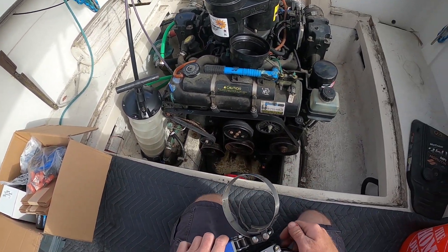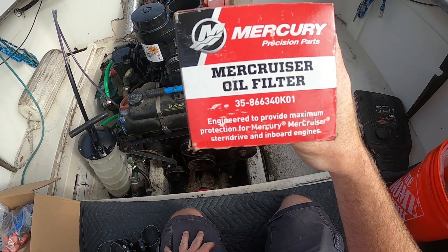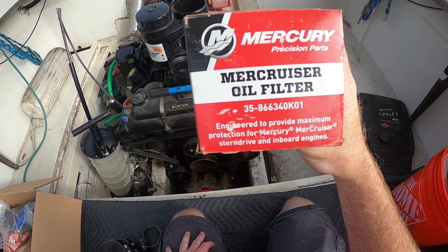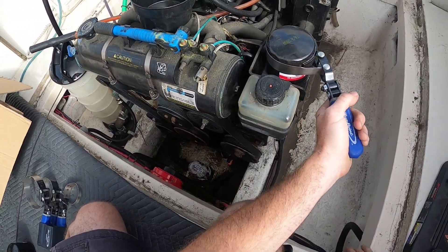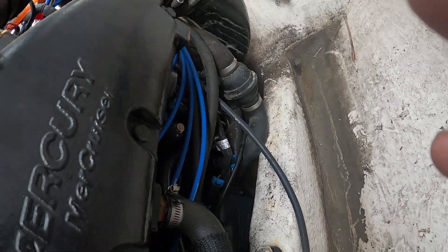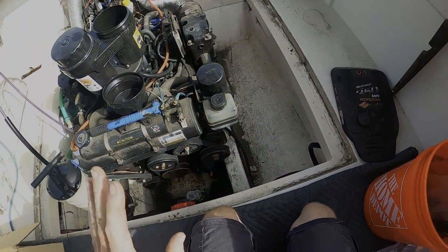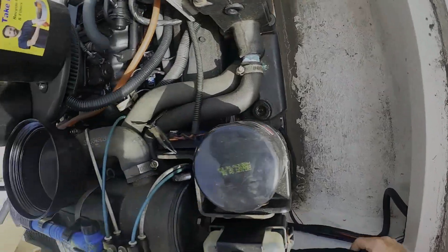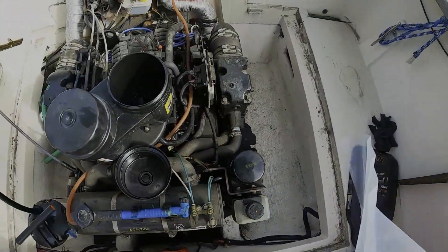We can see our oil moving through the tube, so we know we're good — we should have about five quarts come out. Our oil filter part number is 866340K01. To remove it, simply grab a strap wrench; sometimes these are on really tight. If you do not have an oil filter up top, it will be down underneath. I always recommend adding the remote oil filter system. To prevent spills, I strategically position rags underneath the filter assembly.